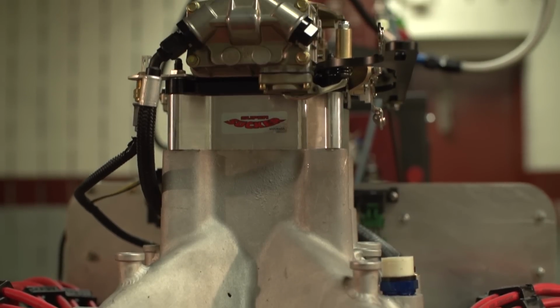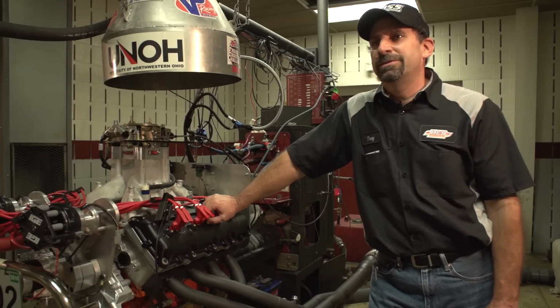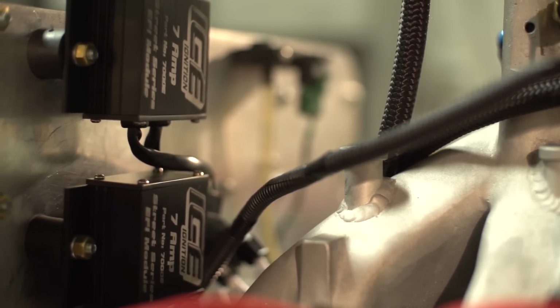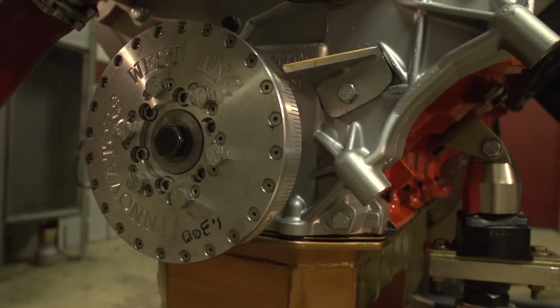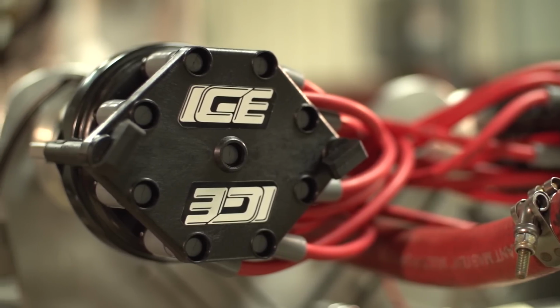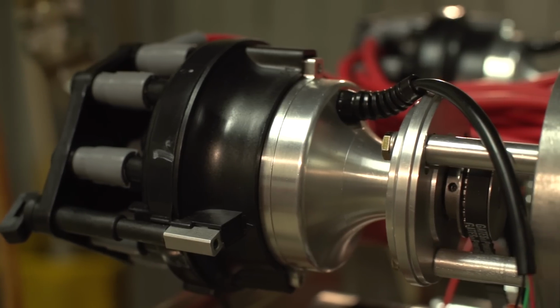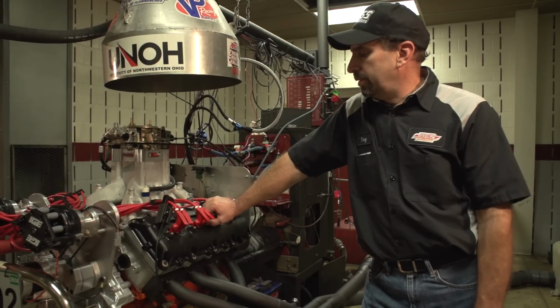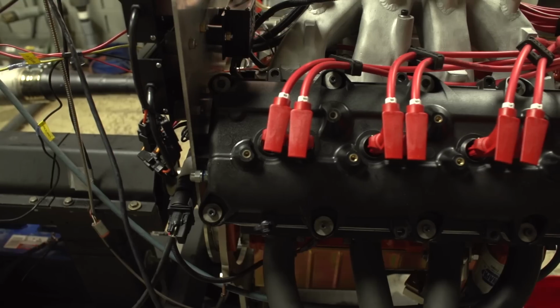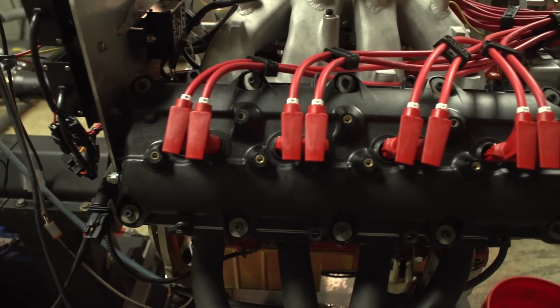Again, we built a Hemi a couple years ago and did real well with it, and these are really stout motors, especially per the rules, to make mid-range torque. We've got a relatively small bore, 3.967 bore, and a 4.050 stroke. We run Jesel rocker arms, Comp valve train. We've got 1.9 ratio rockers with about .430 lobe, which puts the gross lift probably about .820 lift.